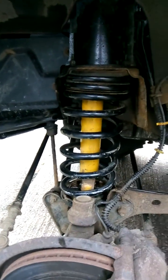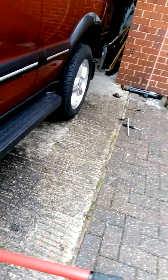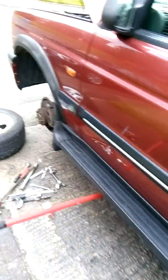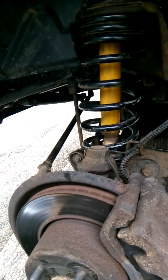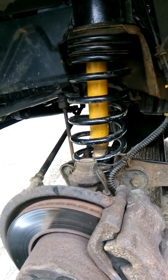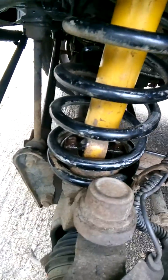Here's a little trick. I changed the rear bags to springs on a Discovery 2 and noticed I also had a front road spring that was snapped. I asked the breaker for some new — well, used — springs for the front and they only had rusted-out ones like the ones I took off, but they told me that the rear springs actually fit on the front — same diameter — and it's actually true, they do fit on the front.